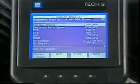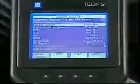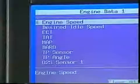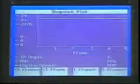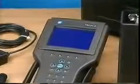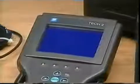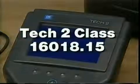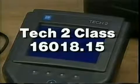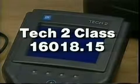While in Snapshot, you have the option to plot data on a graph. Select Plot, then select the items to be plotted. After the selections, press Exit to continue plotting. Using the TECH 2 for SPS, as well as all its important functions, are thoroughly covered in the one-day TECH 2 class, number 16018.15, available at your local GM Training Center.